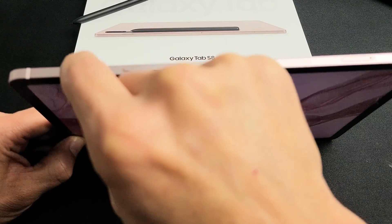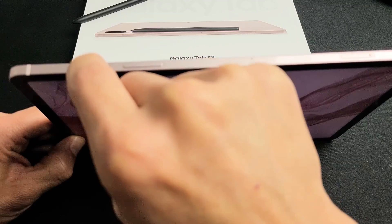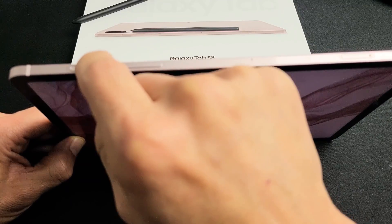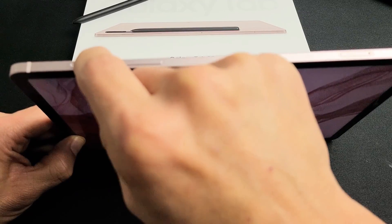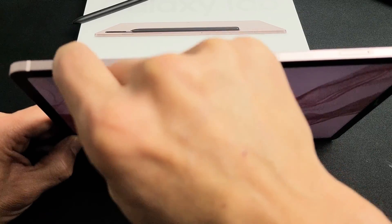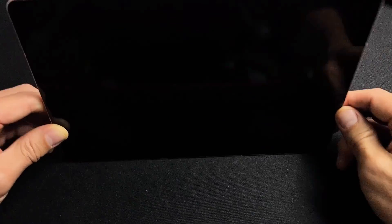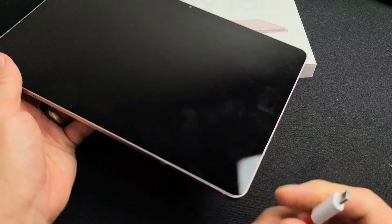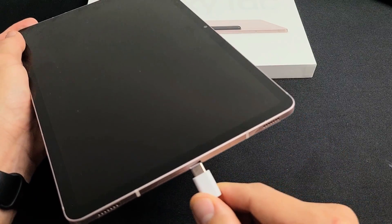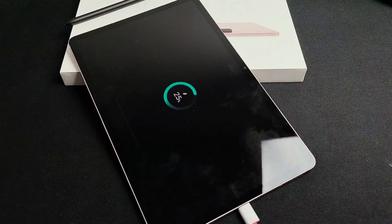What can happen is if your power button is not functioning properly, or it's stuck, jammed, or maybe you've got soda, water, or coffee in there — it can cause boot loops as well. So spam it a bunch of times. Now we're going to grab our charging cable. What we're going to do is give it a little bit of power. So I'm going to plug it in and wait about five seconds.